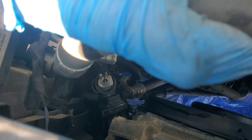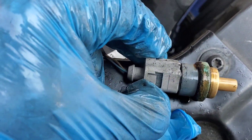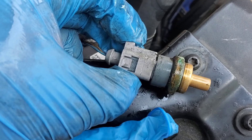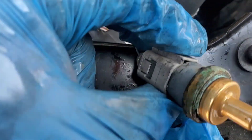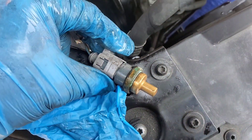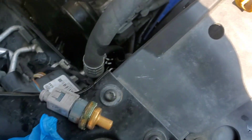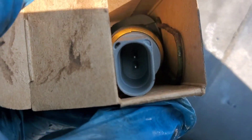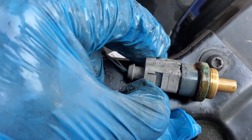It's supposed to be a pressurized system. If the gasket on the cap is worn out, loose, or has deteriorated, it's not going to have a tight seal where it creates a vacuum, and you're going to have boiling at the reservoir. You could also look at the water pump or coolant temperature sensor, and obviously the thermostat. Make sure you have coolant at the correct level and don't have a shortage.